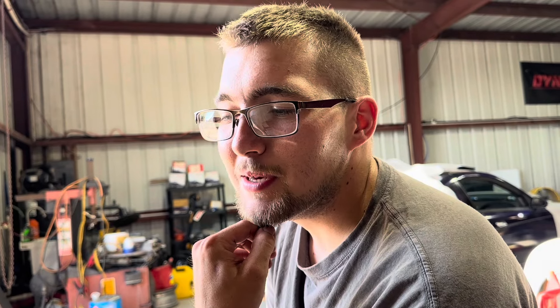The burnout was semi-successful — I got weirded out by how the clutch was acting and didn't want to blow it up two days before a private day. I'll do some street pulls, get more comfortable, and get a better burnout before then. But 371/380 is definitely a big pickup over the two-valve — well over 100 wheel horsepower more, and there's headroom for a supercharger. You also have 1,500 more RPM, which is big: wheel speed in second with the two-valve was about 70 mph on the same 3.73 gear set, now you're going to be 90-plus.